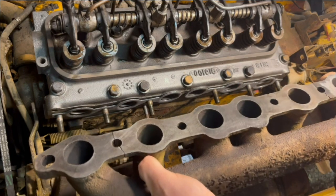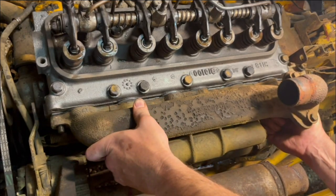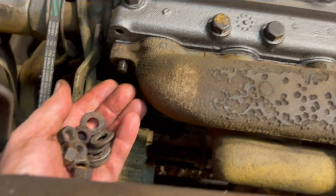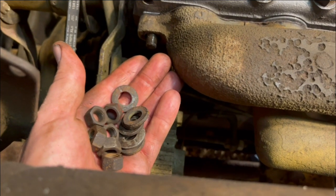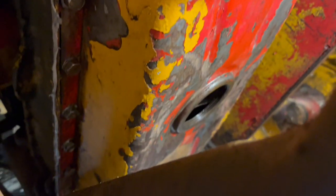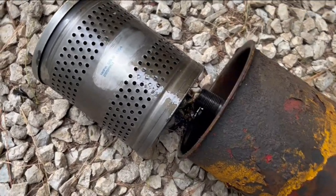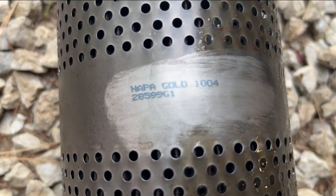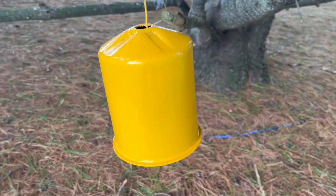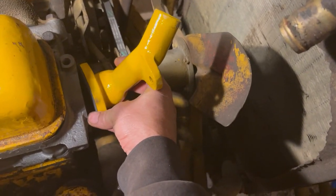New gaskets and combination intake exhaust manifold. The manifold is held on by six studs coming out of the block, tightened on with washers and nuts at 27 pounds. We'll line the oil pan with ultra gray and bolt it on. Let's take a look at the oil filter — we'll get a new cartridge, and it looks like it's a NAPA Gold 1004. The cover was looking pretty bad so we'll sand and paint. We got a new gasket in the pack and our coolant connector goes right on here.